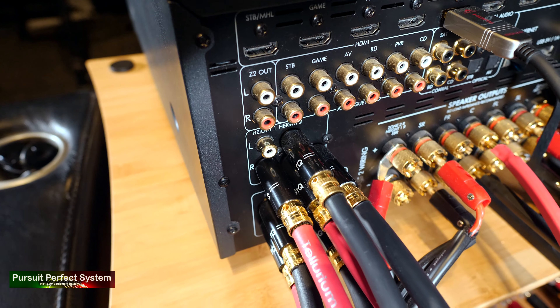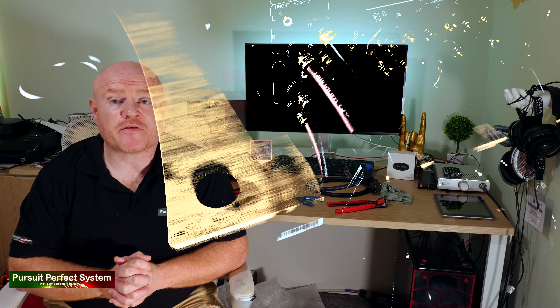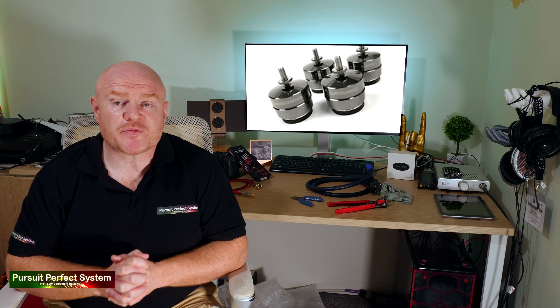That is the only link between the AV system and the hi-fi system, and it's a link I think is really important. If I'm going to be using a stereo integrated amplifier, ideally it needs to have a home theater bypass mode. I've still got the Nagra Classic Integrated Amplifier, which doesn't have a home theater bypass. So how I use that is I use a spare set of RCA inputs — input four — and I literally just turn the volume up to maximum, because that is really no different to using the home theater bypass. With a pre-amplifier of the Nagra's quality, it's such a clean signal anyway that really is not an issue.